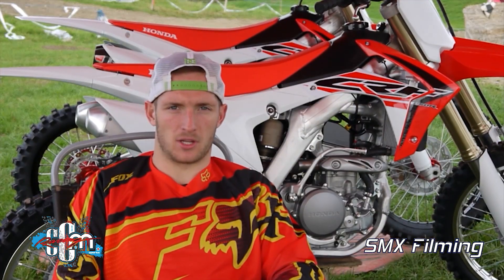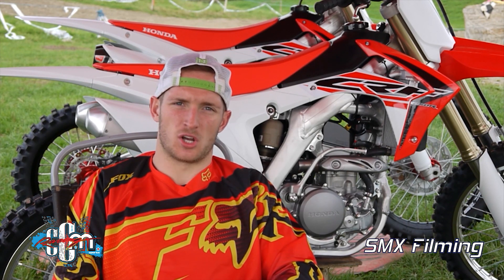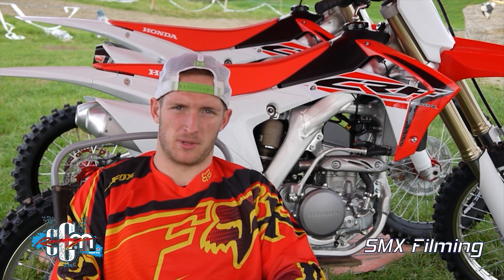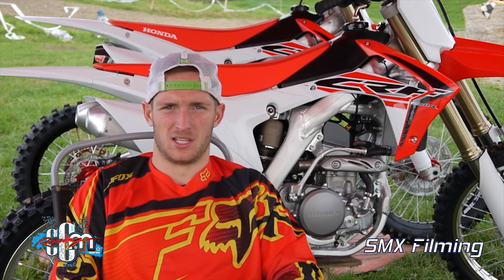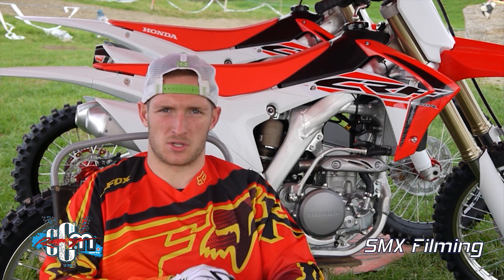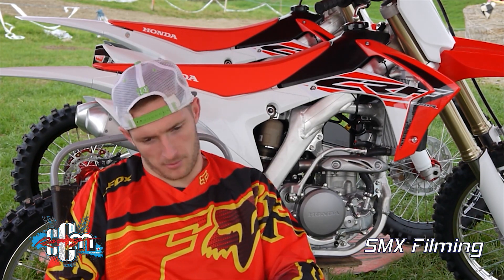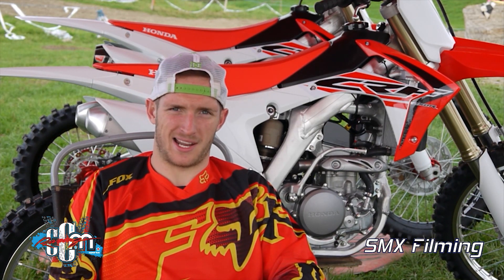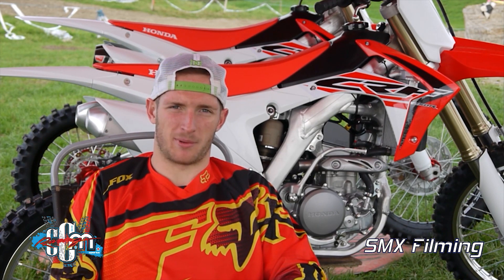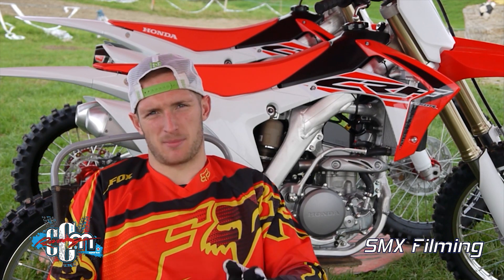The original setup on the Honda 450 was good. I went out for a lap or two then came in to make small alterations to the forks and shock — adjusting compression, rebound, and high-speed as well. One thing I noticed was that all the settings on the shock were on the upper barrel — no up and down adjustment required — so it was a lot easier to alter without having to go from bottom to top and hurting your back. Once I made the settings a little bit harsher, it felt a lot nicer to ride.